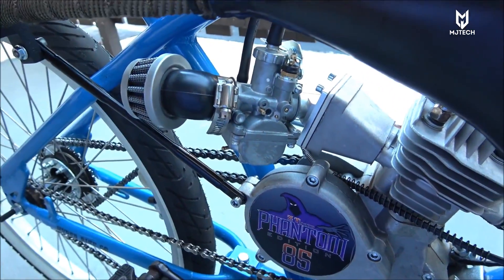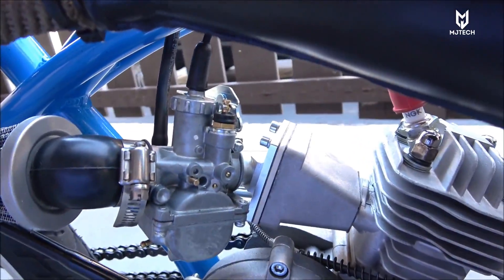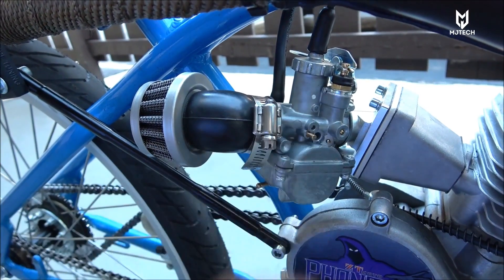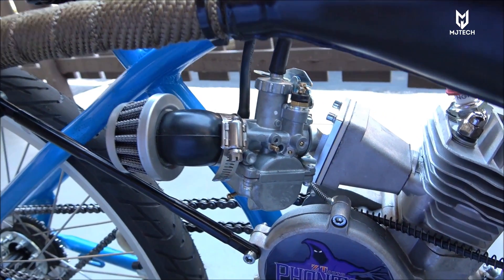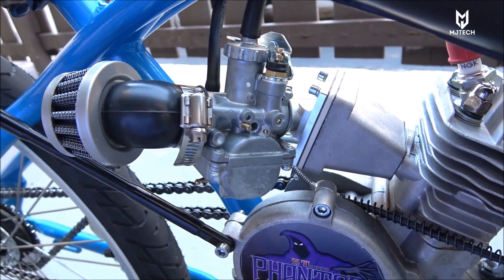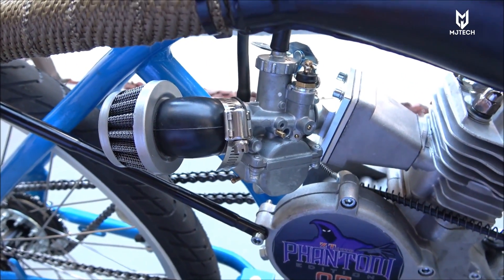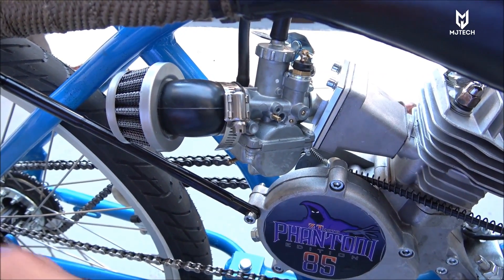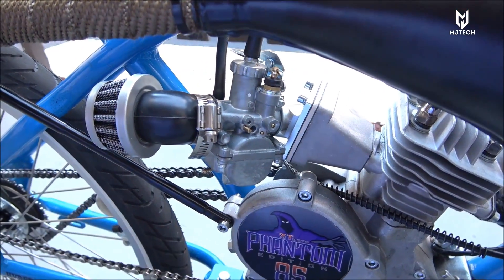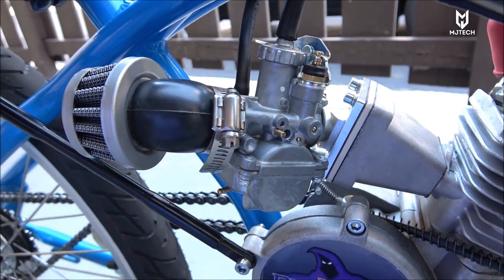I live in West Palm Beach, Florida. For carburetor tuning: the needle is at the second slide from the top. The pilot jet is at number 20 with two turns out on the air screw, which gives a pretty good idle — though you have to adjust the idle screw once the bike warms up. The main jet right now is a 72, but I think I'm going to go down to a 70 or 68 on this Mikuni carburetor.